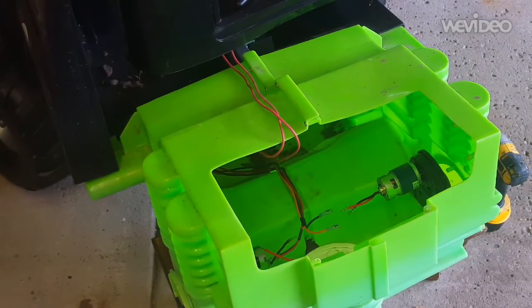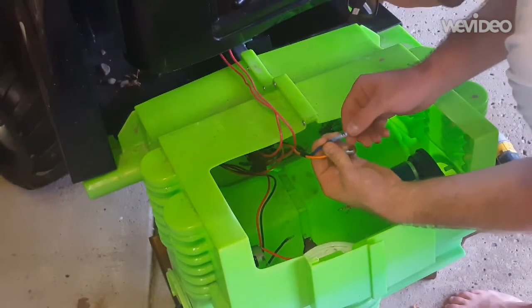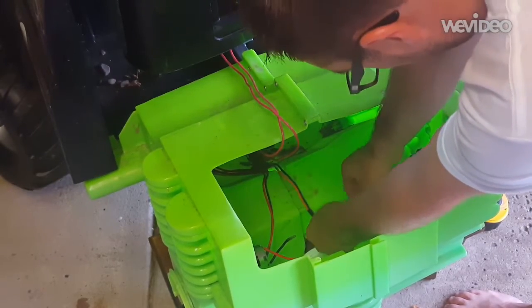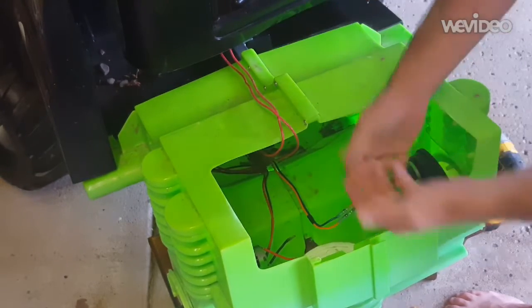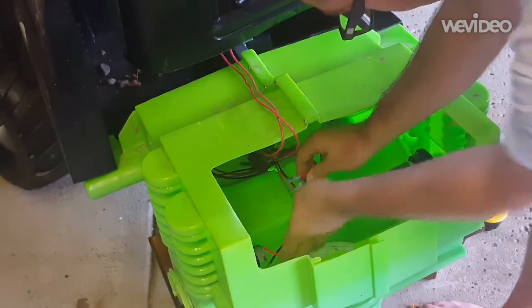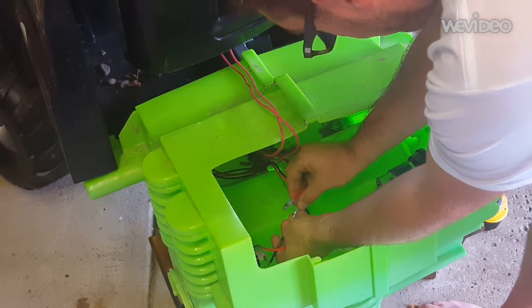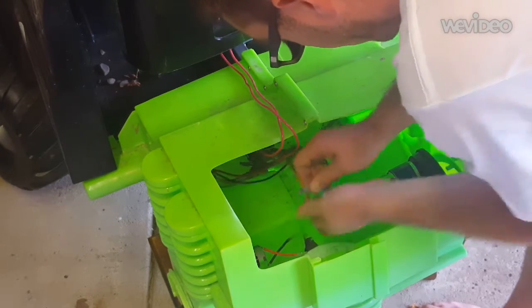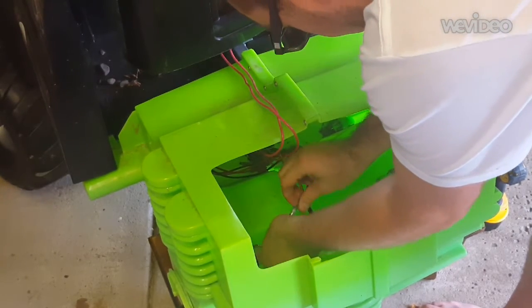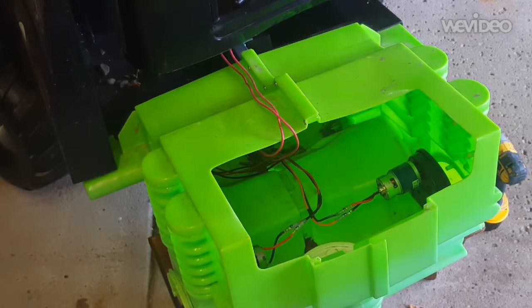Okay, so I've put the quick connectors on the ends of the motors, and therefore when I'm replacing them I can swap them out pretty quick. I've got them labeled already, red and black, because oddly enough a lot of the wiring from the Power Wheels is green and yellow or blue and orange or what have you, so just make sure you get them right, because obviously you don't want your motors running in opposite directions. Got a black on here and then a red on that one. So that's the first step in reassembly, and we'll put the axle back through in a minute.